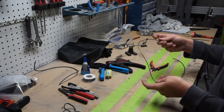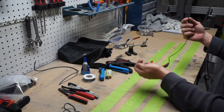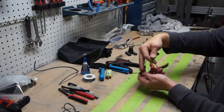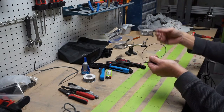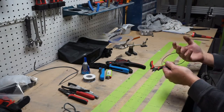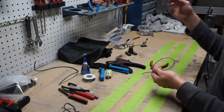Now what you've got to take into consideration is where you want that splicing in your system. If we were to hold this in the system right now, we'd come out of the power supply, go back to the grommet, up, do another grommet, into the board. Well, you don't want your splice on the back side of the motherboard tray, because that's going to add some width to it. And if you want to dress up the back, you're going to have this nice big splice in the middle of it. So we don't really want it there.